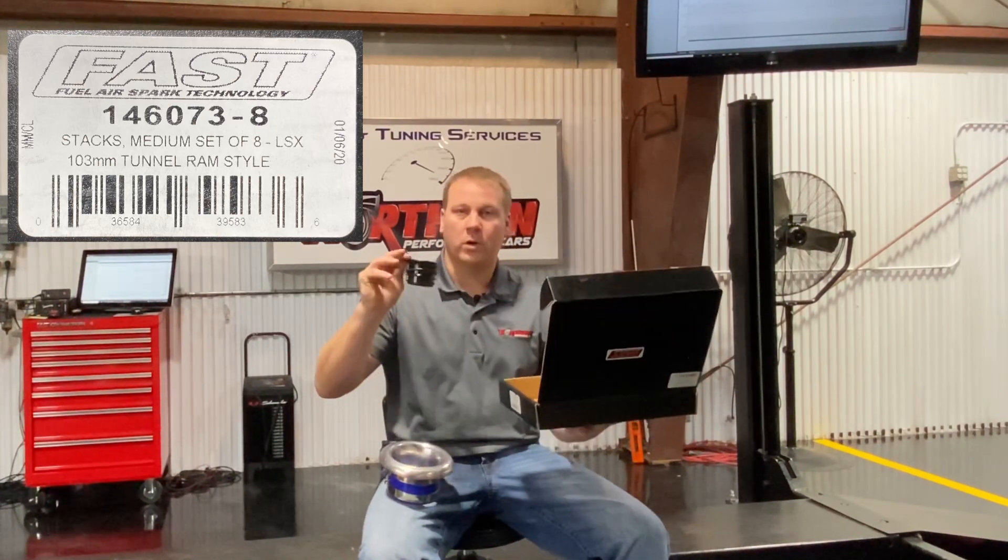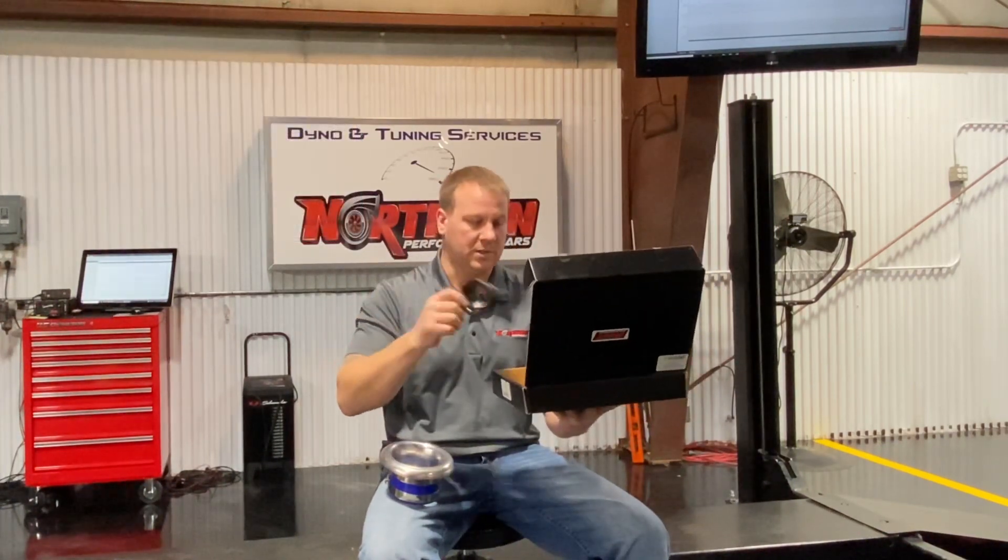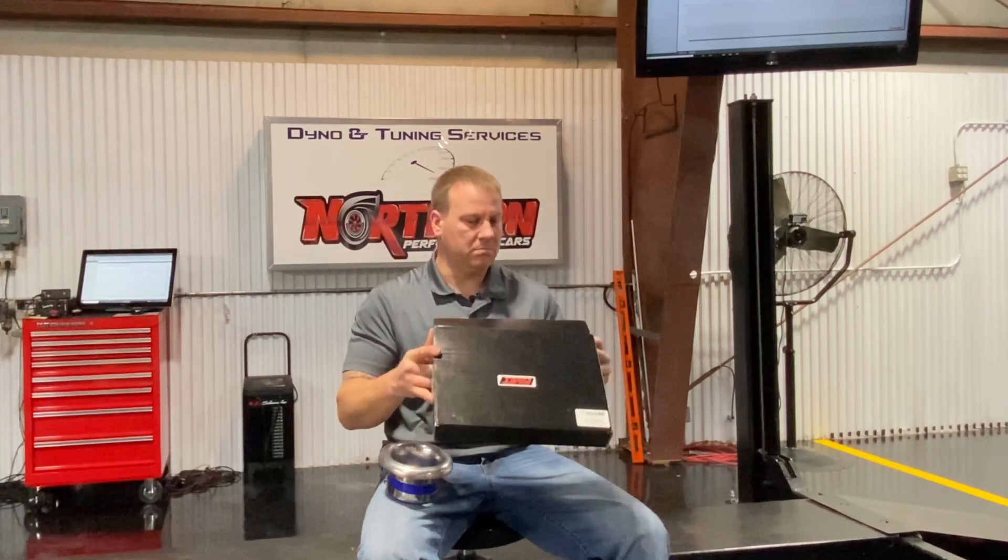These are said to make it like an 8.25-inch runner length. This did what I was thinking — it was very close to what the long runners were. Lost a little bit of torque down low, but really carried power about 200 RPM higher. These were pretty decent gains everywhere and not a lot of loss.